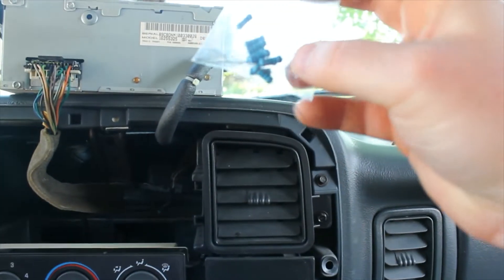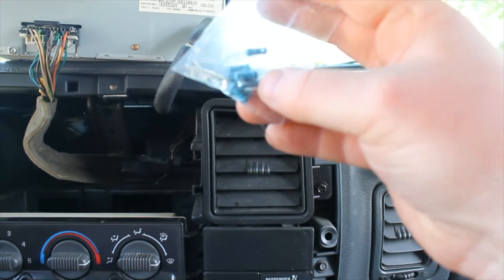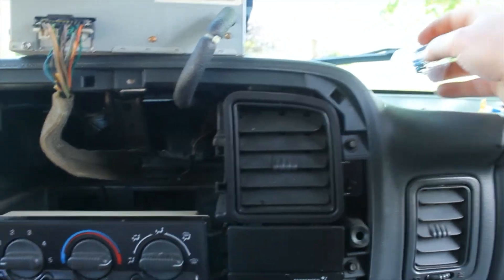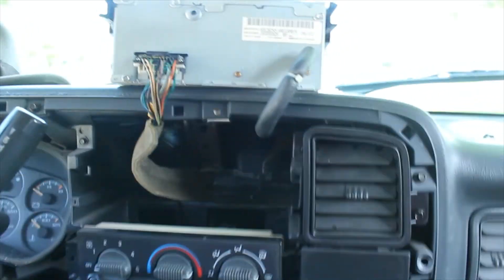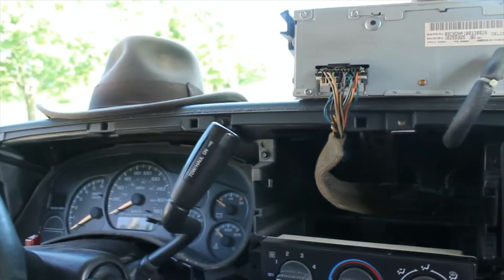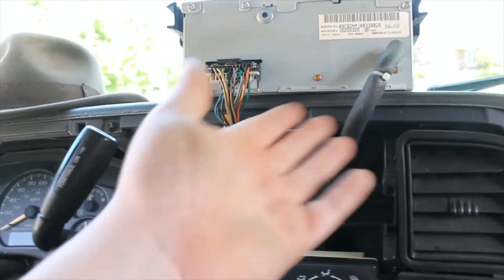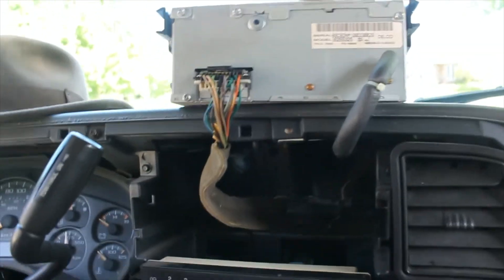You'll need to order resistors off Amazon — I got a bag of about 20 of them for 69 cents. It's basically a plug with two holes, and you stick one end of the resistor into each hole. That causes the signal to reroute so it thinks the sensor is working, no input detected, lights don't need to turn on. You also don't need to disconnect the radio — it fits out just fine.